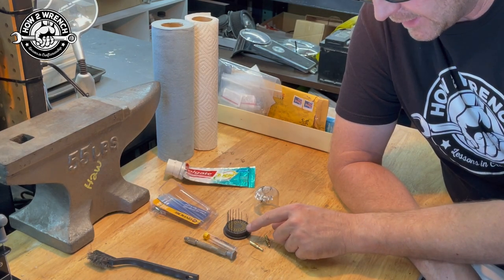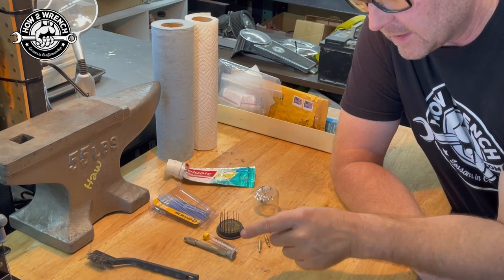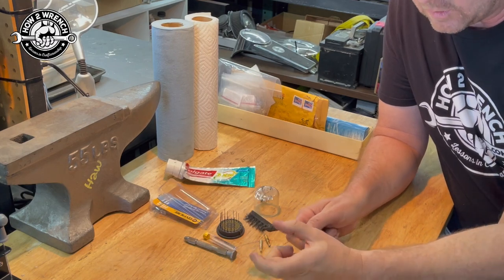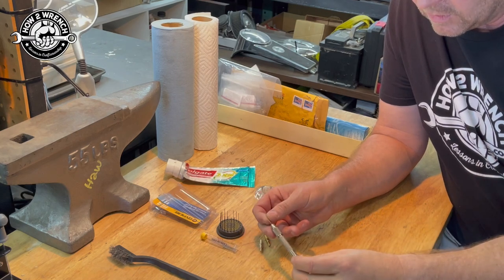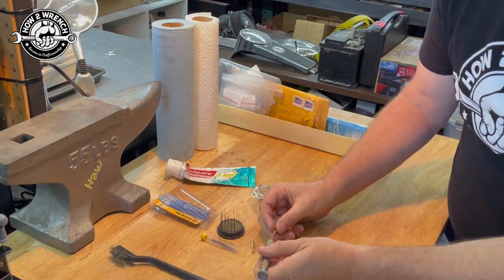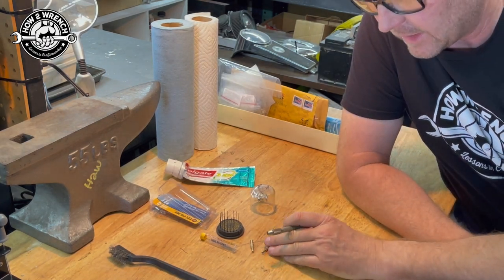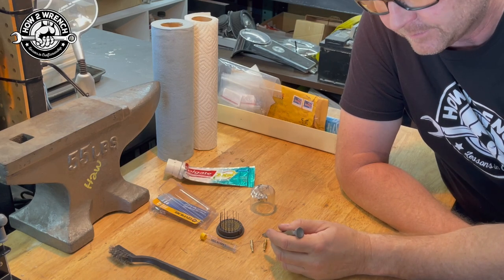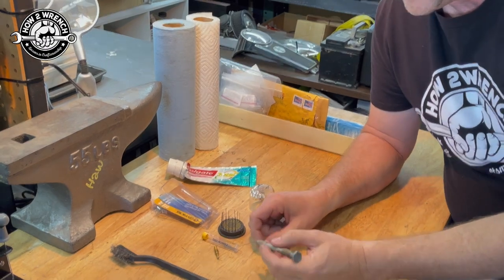My number 80 drill has been broken for quite some time and I haven't even gotten down to the 79, 78, or 77. Last week doing a set of carbs I had to do the old trick of cutting a piece of wire from a welding brush, putting it in a drill holder, and poking through the jet. Usually just getting the start of the blockage opened up lets your parts washer, ultrasonics, or vapor blasters take over — but when it's plugged solid with no way to get it started, there's just no winning.